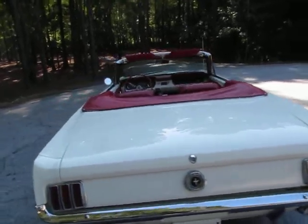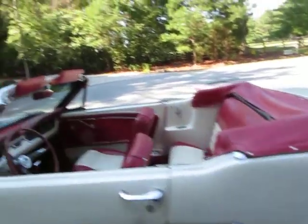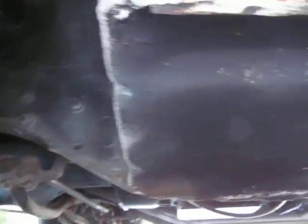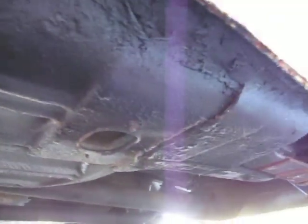Like we said, in pretty good condition — a little bit of rust here and there but nothing super uncommon. You showed the bubbles on the door. I would call this a very minimal rust car but I couldn't call it a rust-free car — there are a couple of spots, a little surface rust up in here. The rockers look solid, the inner fender wells are all nice and solid, floor pans look really good. There are just a couple of little rust spots which could be repaired quite easily.